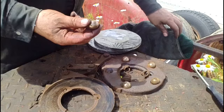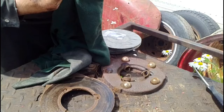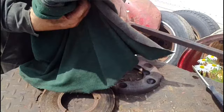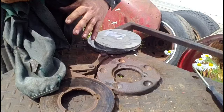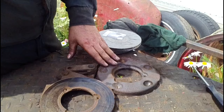The first thing is to inspect the balls — these ones actually look in pretty good shape. Sometimes they'll be quite rusty or pitted, and if that's the case you want to put new ones in. You need to clean up the little ball sockets where the balls run. We've got some rust pitting in there, so you can use sandpaper, a wire brush, or something like that. I've got a little siphon-type sandblasting gun and that's what I'll use for these.